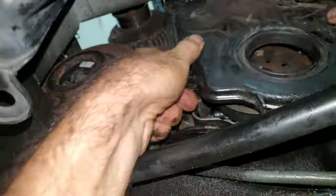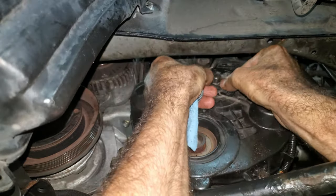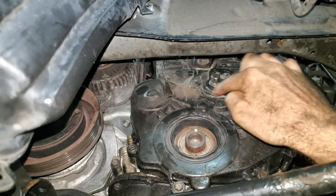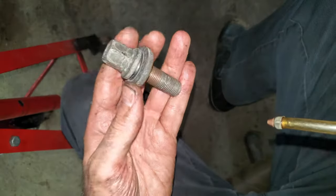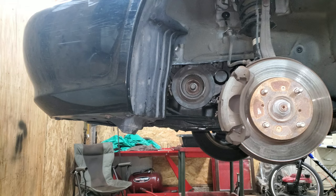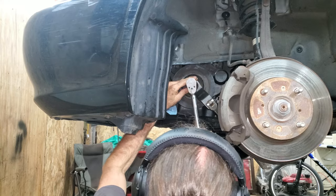Time for the greasy cover — 105 inch-pounds on those bolts. Put the wire back on and this rubbery thing, which I think keeps the cover from warping. A lot of times on these jobs the harmonic balancer touches the cover and wears a big hole in it, so that's probably there for a reason. The harmonic balancer bolt requires oil for a proper torque reading — just one drop between the washer and bolt, a couple good drops total. I need to torque this down to 181 foot-pounds. It's very crucial — if it's too loose, this balancer can come right off, and I've seen it happen.